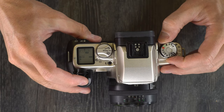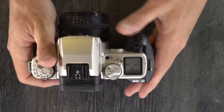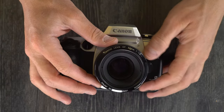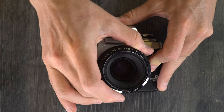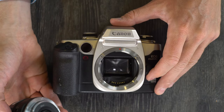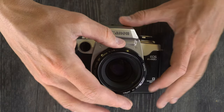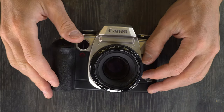You verify that the battery is working just by turning on the camera, and you'll see a battery strength display on the LCD screen. Next, let's talk about how to mount and unmount lenses. You push down the lens release button and turn the lens counter-clockwise to release it. To mount a new lens, line up the lens index and the mounting index, turn clockwise until it clicks in place.